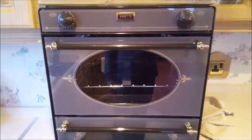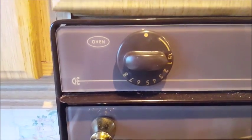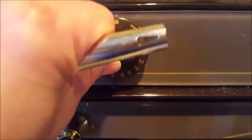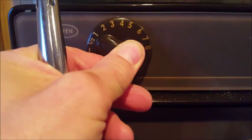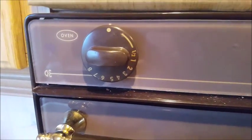If you're using the oven, turn this knob round — you need to push it in and hold it in. With two hands: hold that knob in, open the door, pull that out a bit, and right at the back use your clicker. Put your hand right in to the back and light the gas in there.